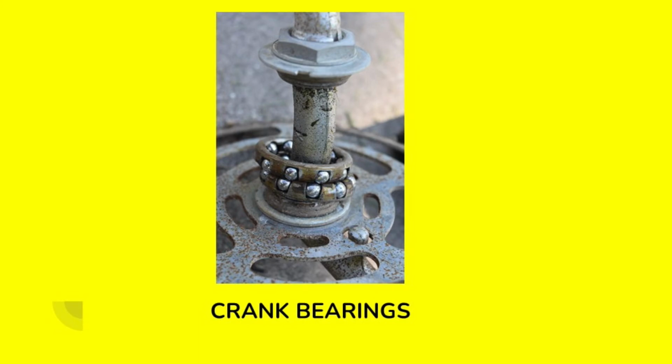Now, these are the crank bearings from this bicycle, and the grease that was on these has solidified and become sticky and gooey, and there's dirt in there. The bearings themselves are actually in pretty decent shape, so a bit of cleaning and some fresh grease, and these bearings are going to be just fine.